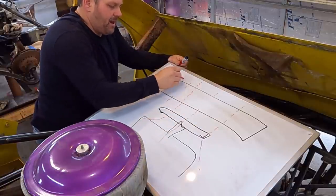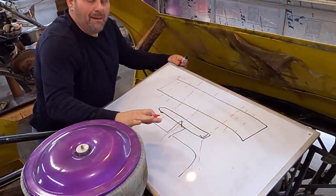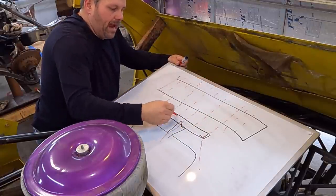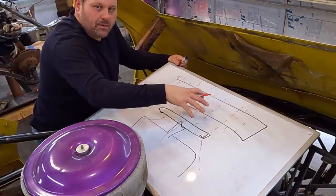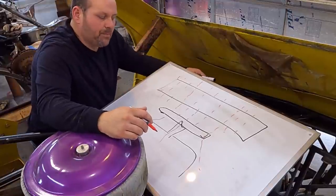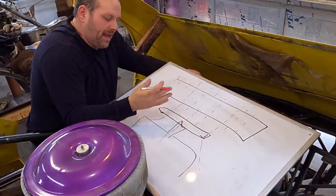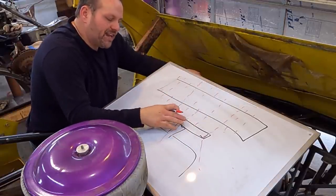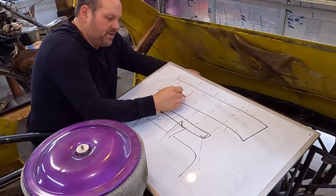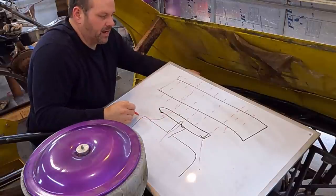And we say, well, yeah, we lose a little bit on these edges. That's not what happens. When you're at low RPM, air will flow through here similar to this. Like when you're idling around the pits or you're just in the shop, it'll pull air through. This will be sitting here spinning, and as the fan is turning slow, the air will follow this direction. It will say, well, okay, I'm happy with that, and so it'll breeze through like that.